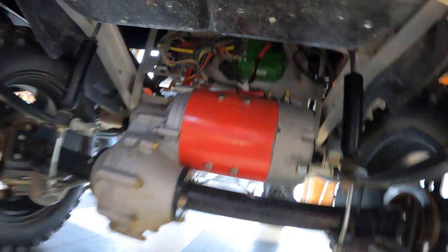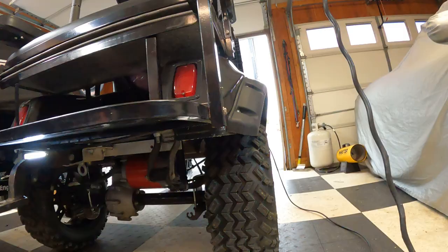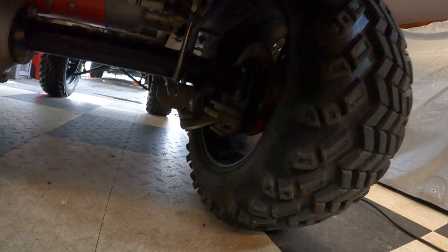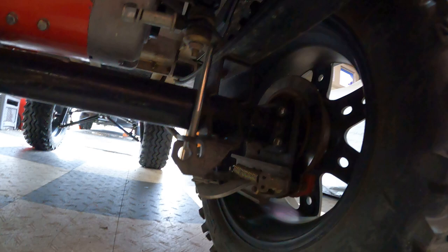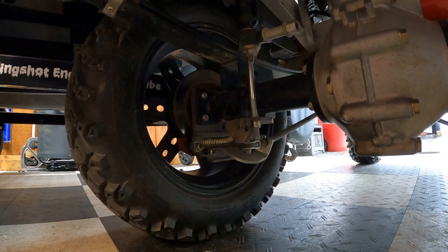It just has the standard 6-inch lift in the back. One of the best things you can add is a reverse light. It also has ASCO disc brakes on the back — about $400 if I recall. If you've got the regular drum brakes, this is a huge improvement. I know they make hydraulic front brake kits nowadays, but if you want to stop, start out with this — it's the way to go. I've never replaced the brake pads and have only adjusted them once in probably nine years.